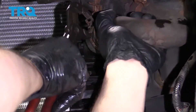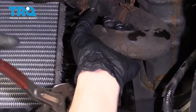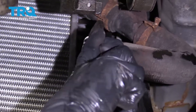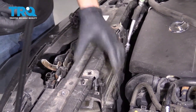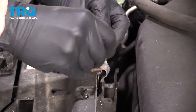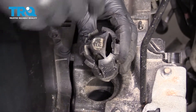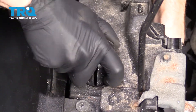Now we're going to put on our lower radiator hose — try to slide it all the way up to its mounting position as close to the radiator as possible, making sure it's as even as possible, and make sure the clamp is approximately in the same spot as when you took it off. Back up top, put this piece in here and put in our push clips. Pay attention to the writing on it — you're going to see an arrow and it says FR for the front. Line this up, and if you need to move the radiator to get it lined up, just wiggle it.